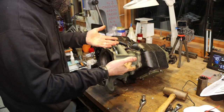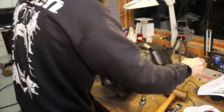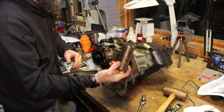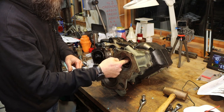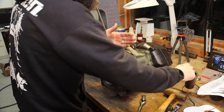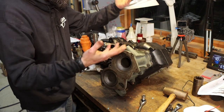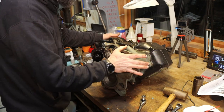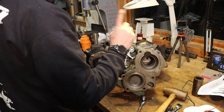So on a side note, I cleaned up my transmission transfer case adapter, put a new seal in it as well, and the transfer case connects to the transmission through this spline shaft adapter, which is pretty neat. And the seal that I replaced keeps oil from going from one case to the other, or, you know, leaking out on the ground. So now I can hook the shifters up and give those a try.